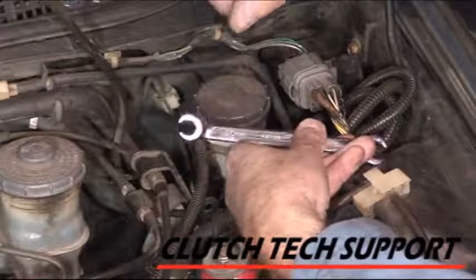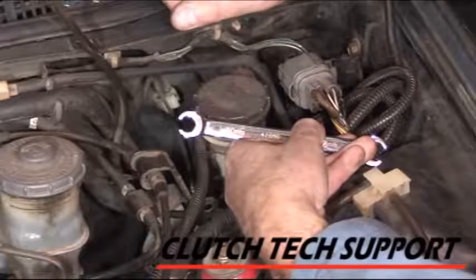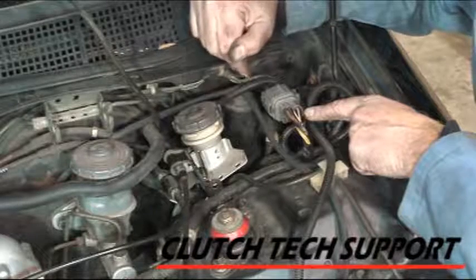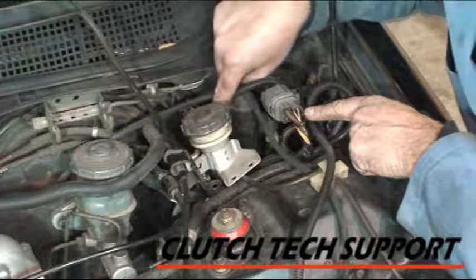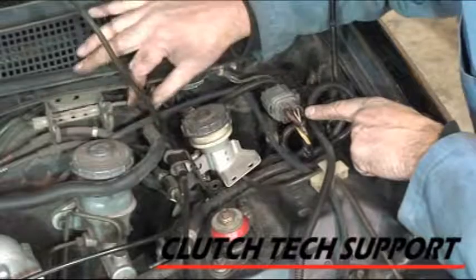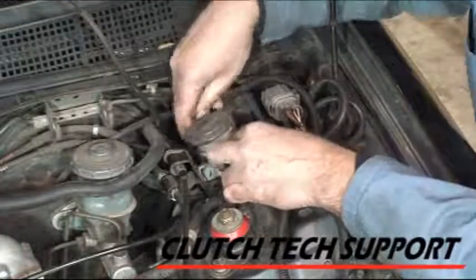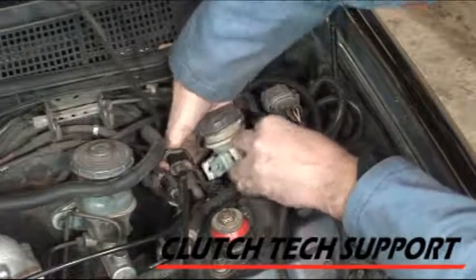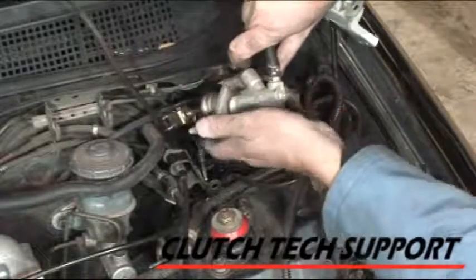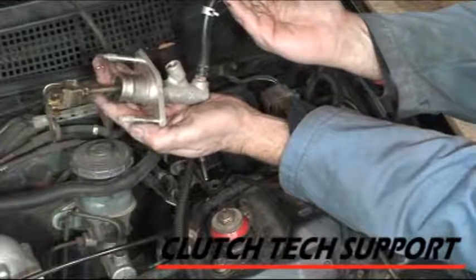Here's the other style line wrench — it wraps around the nut on the line. These are really a good investment and save you some grief. On the inside, on the firewall side, there's a pin that goes through the push rod and just two nuts that hold it on. I went ahead and removed the bracket over top of the brake booster that holds a couple of lines and carries the clutch line. This allowed me to slide the clutch line up just a little bit. Always watch out for getting brake fluid on painted surfaces — and there's the master cylinder.